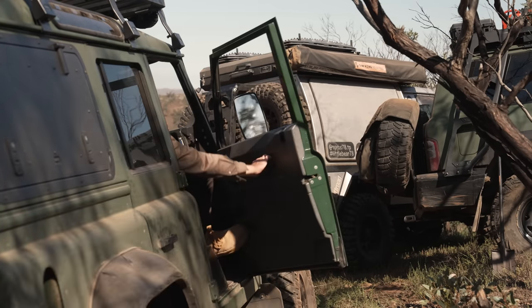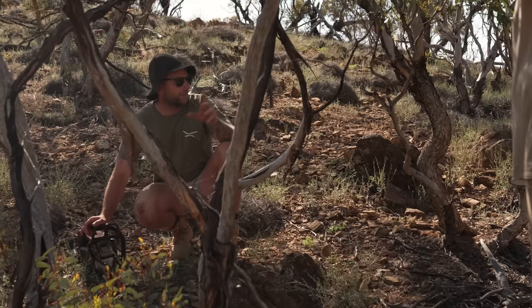All four up, beautiful. I was a little bit worried about that one. I have had a bit of a tune. So revs below 1200, I have increased fuel a bit, so down low it's starting to pull a little bit harder, so I reckon that has changed my ability to climb a steep hill, which is great news.